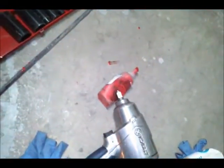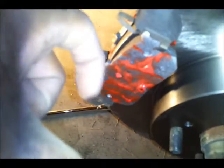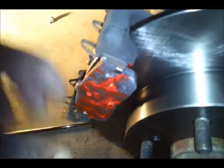Now since I had the brakes, I went ahead and used brake quiet. You know, you don't got to do that, but these are cheap pads. We put the brake quiet on the outside where the actual calipers hit. This one's a little different. That's why I didn't even have to put it on this side, because the caliper piston is only on this side. Alright, it might still make a difference, I'm not sure. Doesn't really matter. It's worth me just putting it on both sides. Now what we're doing now is using this tool.